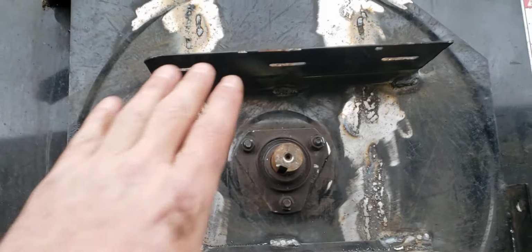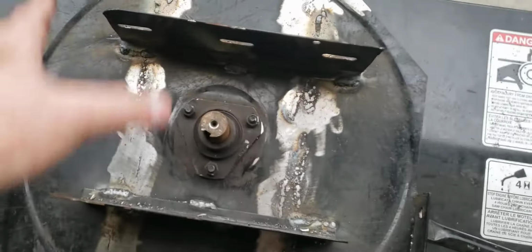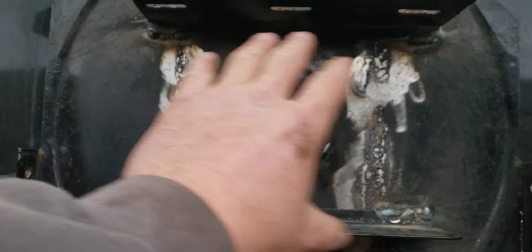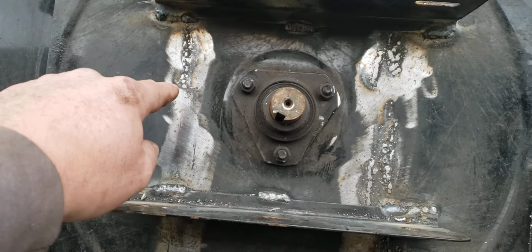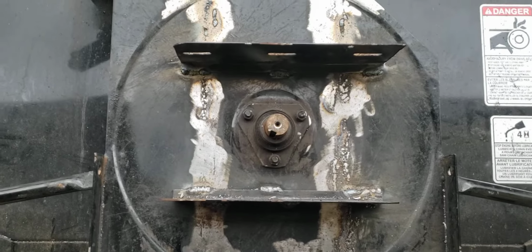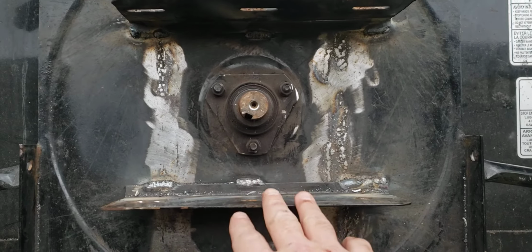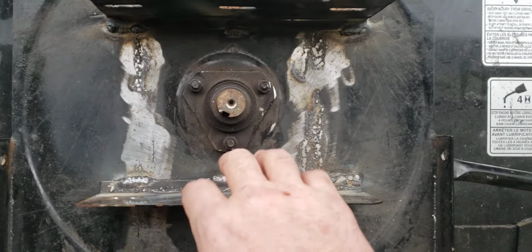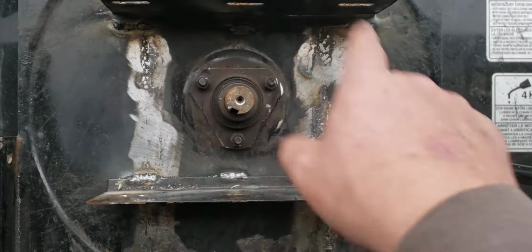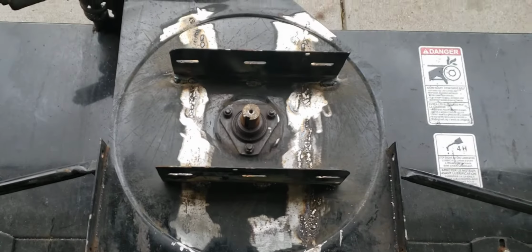It doesn't bother me. So I took this harness and flipped it 90 degrees to the left, so you have the small pulley here and the larger 36 tooth will go on here. I've had the adapter for the small sprocket test fit, and right now it is going to work. The rotation is correct as well, for those wondering. The John Deere PTO, at least on the X series, and I know on the 1 series and the 2 series, is clockwise. I'm sorry, it's not counterclockwise, it's clockwise. If you're sitting on the tractor, it spins like this. So if you can imagine snow getting thrown here and out the chute, the rotation is correct.